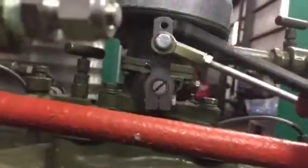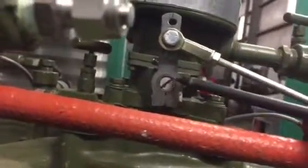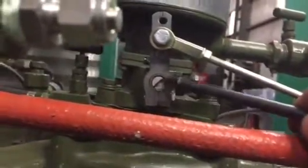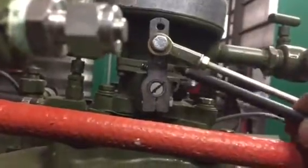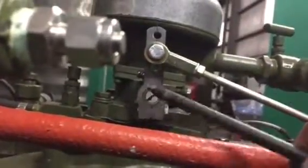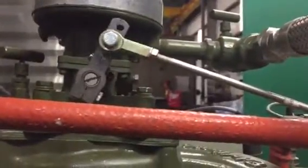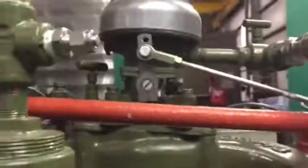With the engine not running, here's how the carb should be set — nice and straight up and down. There's a scribe mark in the end of your carb shaft which corresponds to the butterfly. That scribe line should be in the one o'clock position looking at the carburetor, not running. This will give you full horsepower every time. This gives you a full inch to inch and a quarter of travel — the full throttle movement from fully open to fully closed. With some light spring pressure on here, that's how it will all be set, with the butterfly in that position.